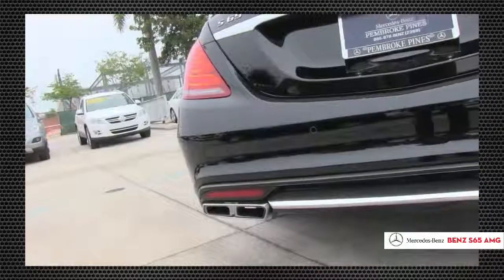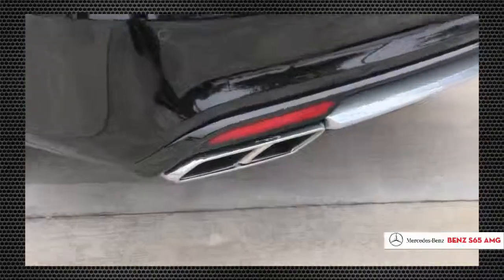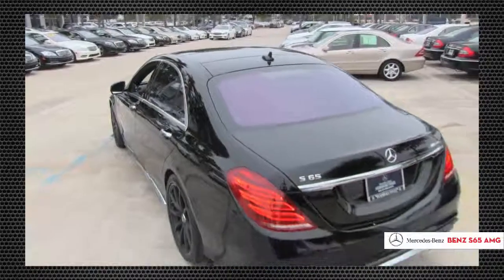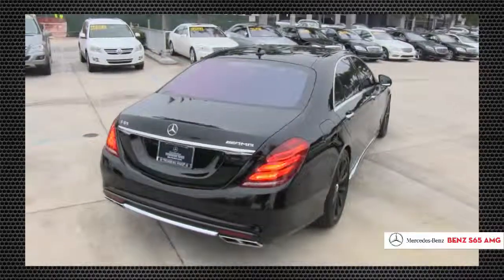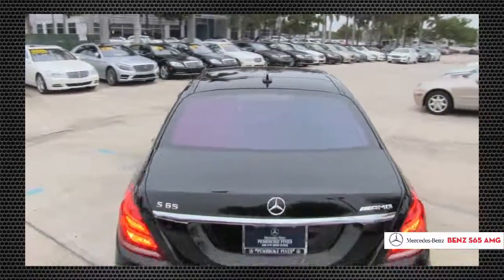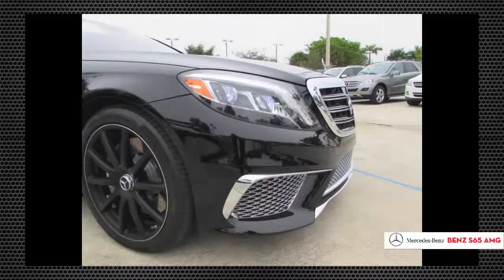If that's not enough, Dynamic Cornering Assist provides torque vectoring, which applies the brake to the inside rear wheel in hard corners, reducing understeer and increasing turn-in by distributing more power to the outer wheel. Another new technology known as Magic Vision Control allows the rain-sensing windshield wipers to have integrated solution dispensers, rather than the cowl-mounted washer jets. It dispenses the right amount of fluid without temporarily obstructing vision. It also has programs for summer and winter modes with heated fluid.